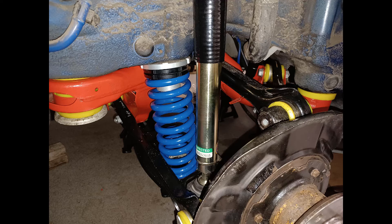The other mistake you might notice is the shock absorber has the adjuster pointing forward. That's a bit of a mistake because once you've got the drive shaft in, you can't get to the adjuster. So actually I turned them round so they face backwards. Just a couple of notes.